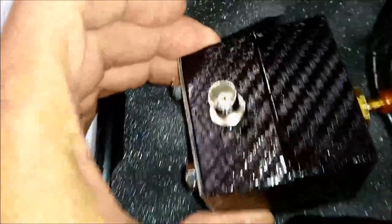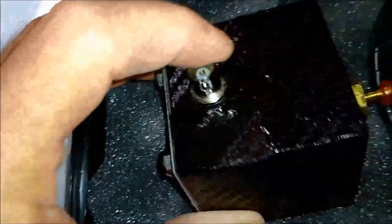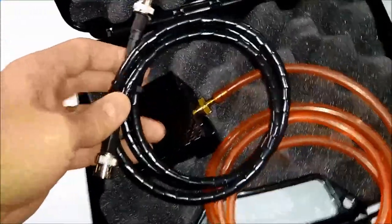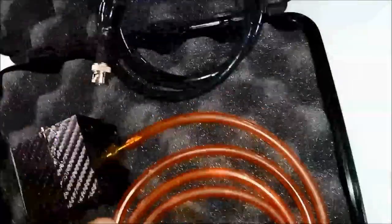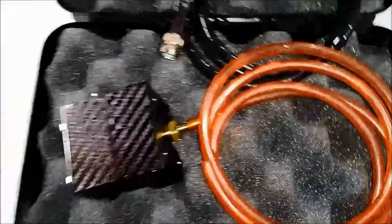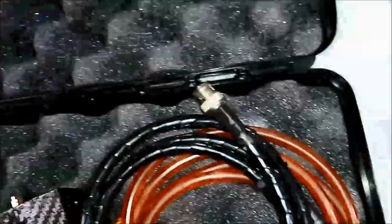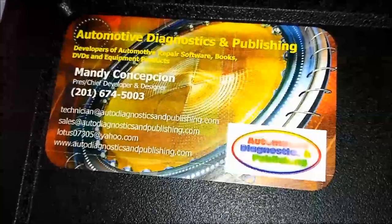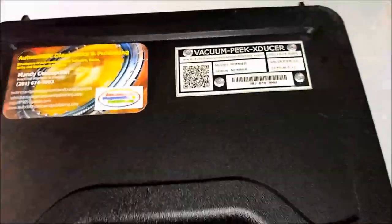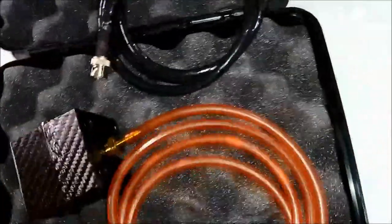The tool comes in its own pouch. It's made out of reinforced aluminum with some carbon fiber around it, so it's a tough unit. As you can see on screen, it has a BNC connector that goes to your oscilloscope. It's a rugged unit. It has a fitting to take vacuum readings — vacuum and exhaust readings. It's important to understand that this also will do exhaust reading. We have another unit for compression: the compression transducer.